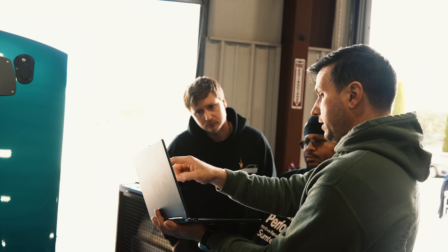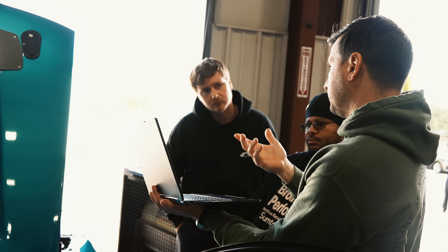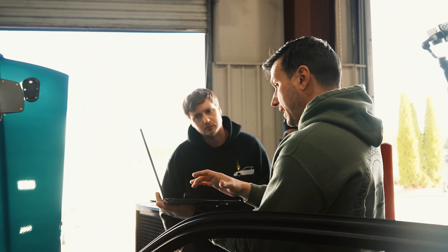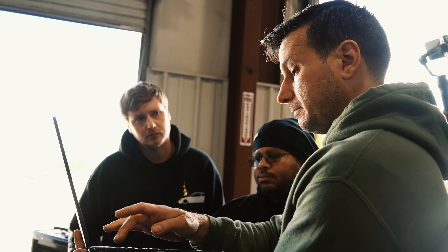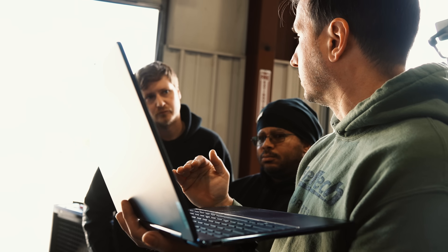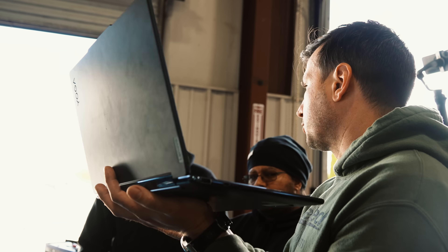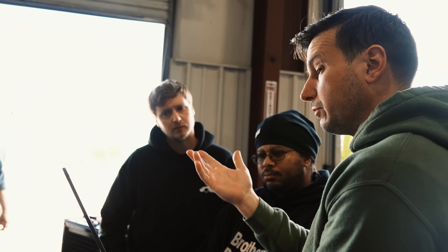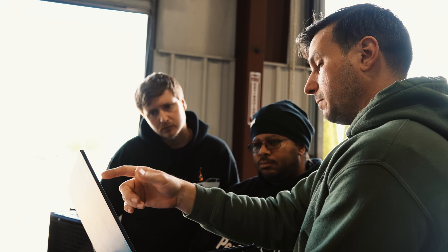A lot of ignition retard with a small amount of cut is normally softer for the engine. When timing is slightly higher, the cut also needs to be slightly higher. When you lower the timing, you can lower the cut; when you increase the timing, you need to increase the cut. Some transmissions want more, some want less, depending on rotational mass in the gears. Which brand is it? PPG — the Pfitzner gearbox. Those are very good, very fast. So normally 40% cut with zero timing should be enough. I'd put something that's normal for almost everything to start — it may be too much, but you'll see from the log how much was actually needed.